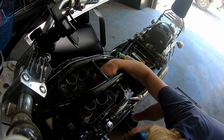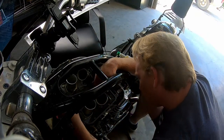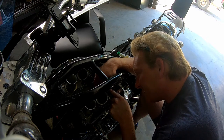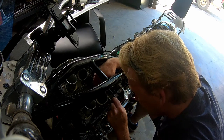Try to make sure all your gaskets are in place — the little rubber pieces in between this aluminum plate and the carburetors. Now's the time to do it if you can see under there. If you pull it up too much, you're just going to pop everything back out of place as far as the horns are concerned.